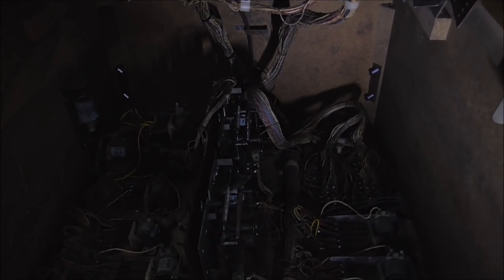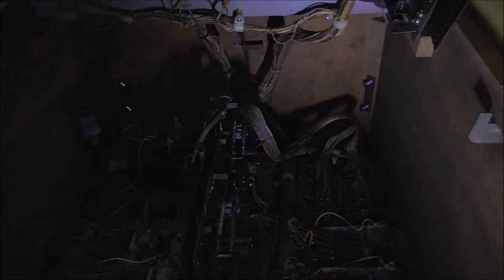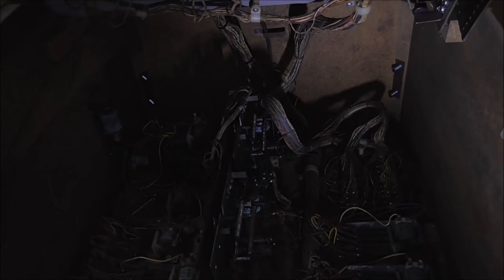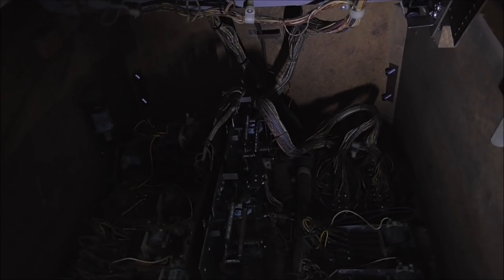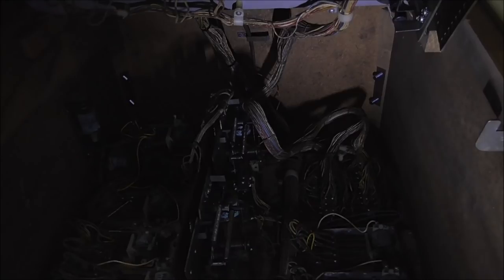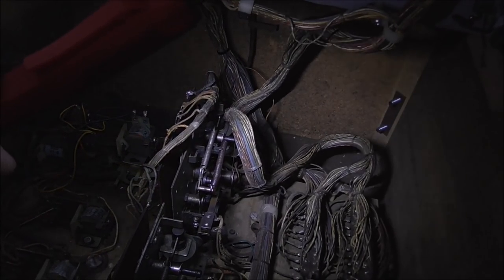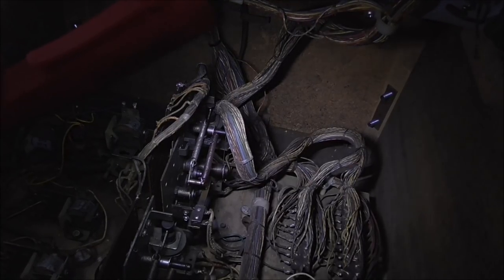Okay, another thing I've been meaning to tell you folks, whenever you're moving the play field around, you can slide it out a little bit and lean it up and all that, but whenever you do, there is a pigtail at the end where the Jones plugs plug in, and it's kind of like a snake. The thing kind of coils around, right? So whenever you go to put the play field back, it's real important that you look at where that is. So if you see, I just had this lifted out and everything, and then when I'm about to put it back, you can see that coil is actually laying on one of the stepper units, right? So I need to move that out of the way.